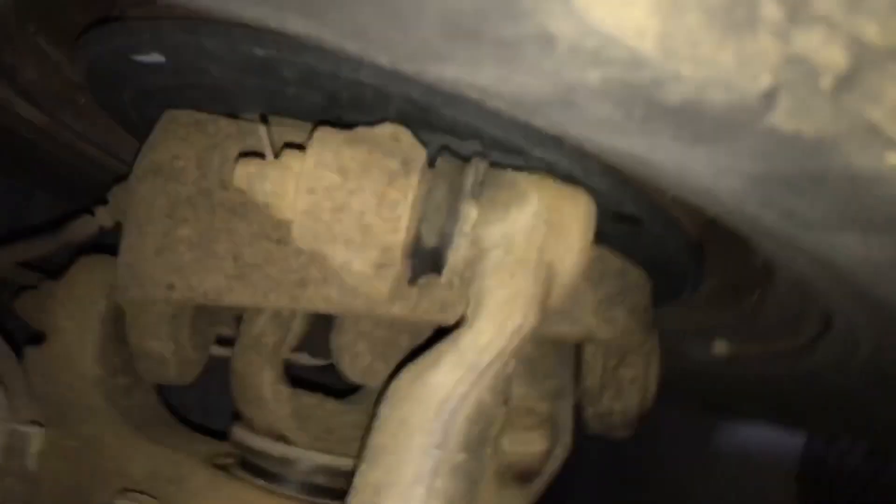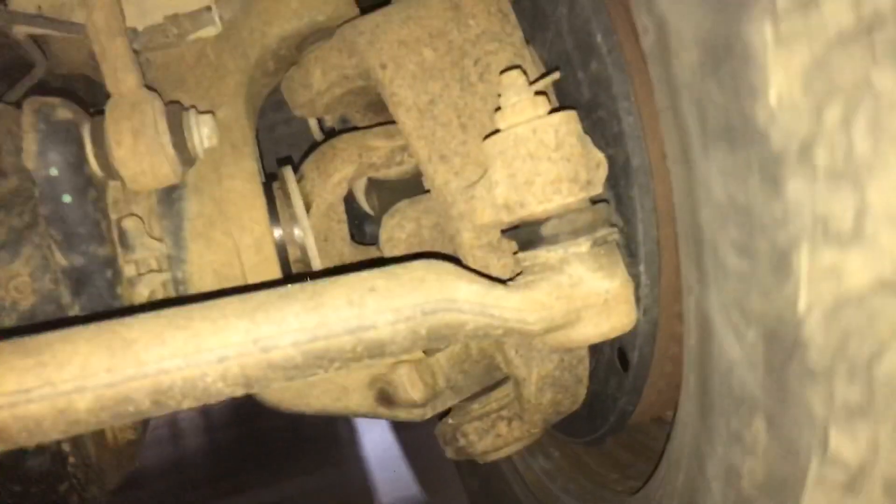They do work manually. We're in two-wheel drive right now, I'm spinning the tire. Go to four-wheel drive — give it a second, we don't expect it to be instant. No lock, no lock. So we got no auto. Could be a vacuum seal, could be a vacuum line, could be a vacuum hub. All I wanted to do right now was see if it worked. We got an issue there. Alright guys, have a good day.